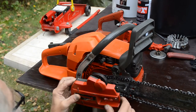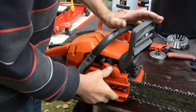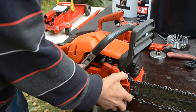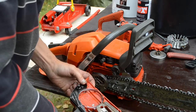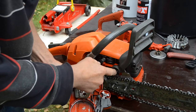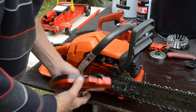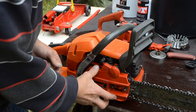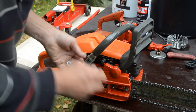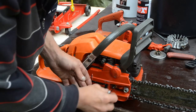Metal, no plastic, should fit for this. Yeah, looks like it fits okay. Go straight into the brake lock. I make sure there is brake on it. Yeah, the brake is there, everything is perfect. So this thing is aligned with the handle, so you switch this to the side and then you lock the clutch drum and then you lock the chain, so you have a functional brake.